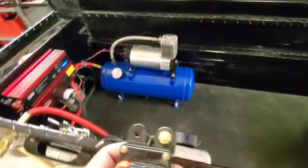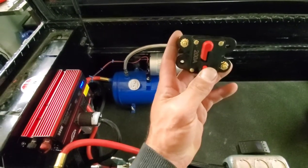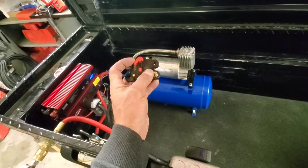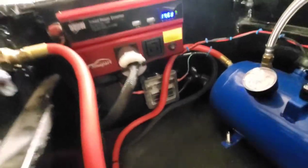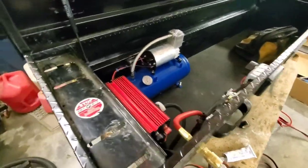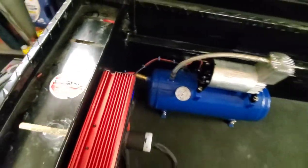This will be Part 1 — Part 2 will be when I'm done with the truck. I also want everyone to know this will have a resettable breaker running along the firewall, so I can kill power anytime from under the hood. If anything catastrophic happens it won't damage the truck. Very important to fuse and protect everything — no shortcuts there. I wire-loomed everything, so get yourself a roll of wire loom and try to keep it all clean. Alright, I'll catch you in the next video.